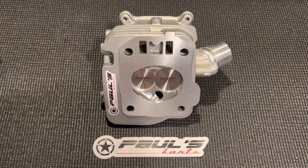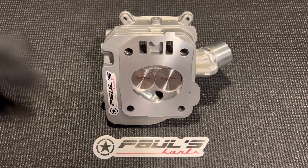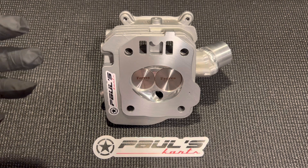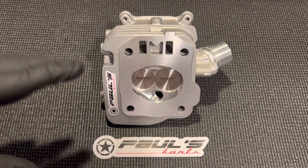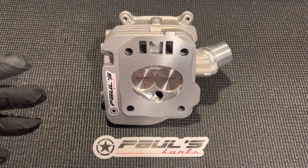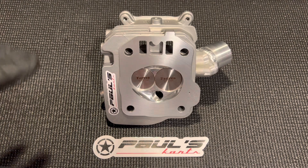When you know what cam you're using — say a 285 or a 265 — you know that the power band is going to be down around 4,000 to 6,000 RPM. If someone's using a 356 cam, you know that power band is going to be higher. So if you know what cam you have, you know what power band the engine is going to operate in. When you know the engine's RPM and volume, you can get the CFM requirements from what that engine needs. We can meet the CFM requirements with this cylinder head so easily that we were able to shape the port completely differently. This head now has the highest velocity we've ever charted, while still hitting the CFM requirements for that bottom end.